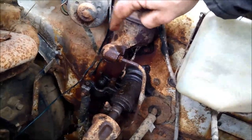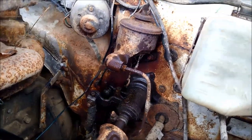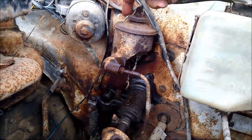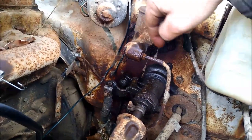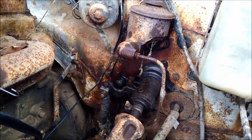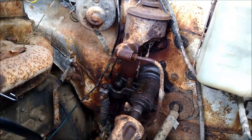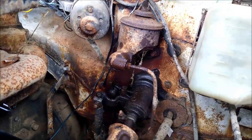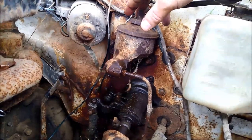When you push on the brake pedal, that cylinder's locked up, so it maybe could be rebuilt. I imagine there's quite a bit of pitting inside of it, as long as it sat. So what I'm gonna do is take this off. It's got two bolts, one there, one there. Should be able to slide this out. If the rod's the same that goes to the pedal, awesome. Hopefully it comes out. Otherwise, I'll have to undo it from the inside. If it's not the same, I've still got the rod from the 59, and it should be close. I got a welder and some other tools if I had to modify something to make it the right length. So, keep plugging away at it.